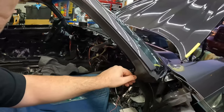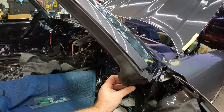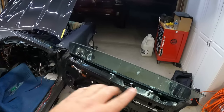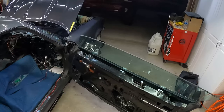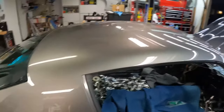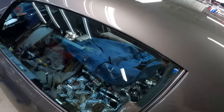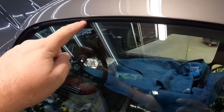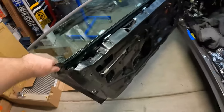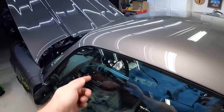There you go — this will sit flush against here once we have the dash in, and it will tuck up when the door's closed for a nice seal. Now that the seal is in, the fun begins of getting your window seated right. I'm not going to go over all the details of aligning the window, but you can see how this window sits nice on the seal — there's a little bit of seal above the window all the way around, nice and tight. When you close it the window tucks underneath.